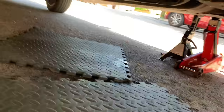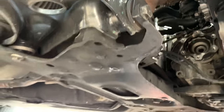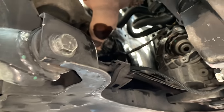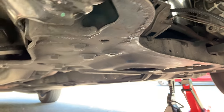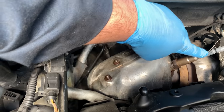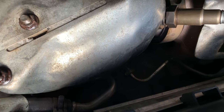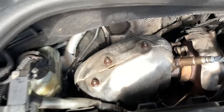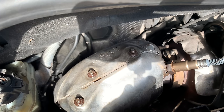I might have a limitation with ground clearance to maneuver it out, so I'm a bit concerned about that. Also, there isn't enough room on this side of the car to get it through, so I believe we're going to have to drop the subframe and steering rack as well. Starting at the top: we have three 10-millimeter nuts to remove first, then an O2 sensor at 22mm, a temperature sensor at the bottom at 17mm, and a bracket connecting to the turbo — that's a 5mm allen bolt.